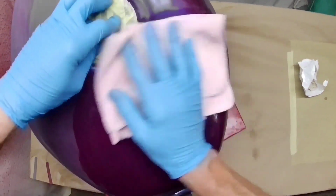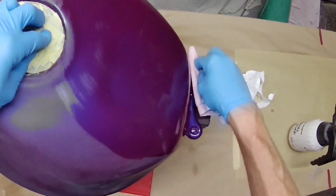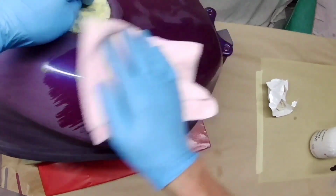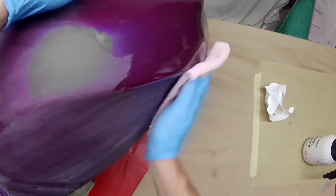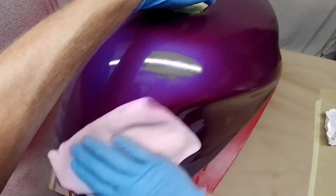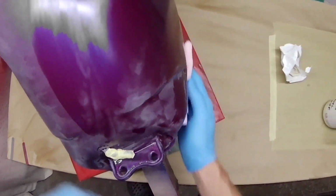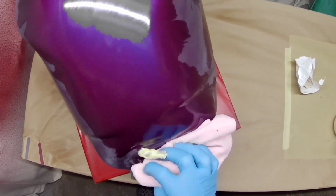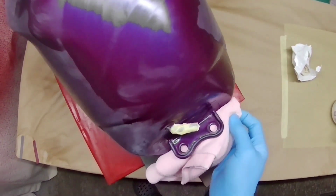But to get to the stage of applying the loosely worded artwork, I like to put a few coats of base coat on it to cover up any little marks, and then a couple of coats of clear coat. We'll sand the clear coat down after a couple of days, then leave it another couple of days, so three to four days altogether, and then you can start doing any stencil work. If you make a mistake, you can just rub it out, which gives you more insurance really. And it gives me a chance to try different guns and things like that.